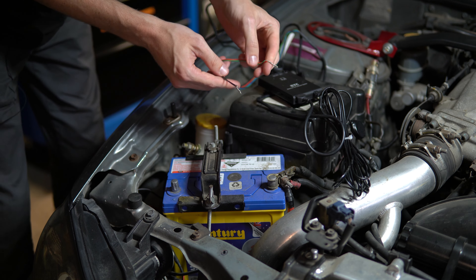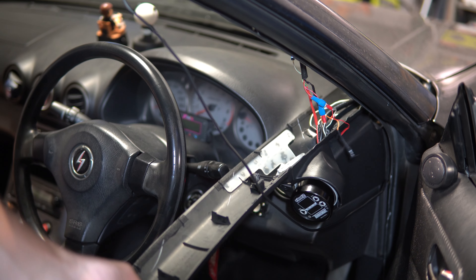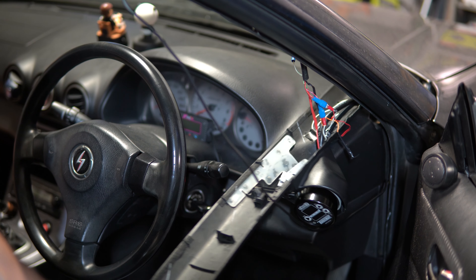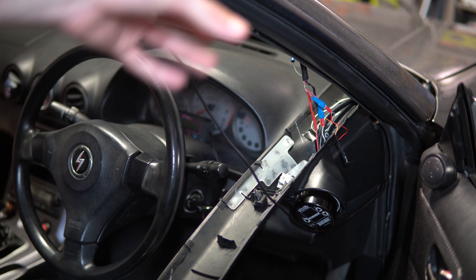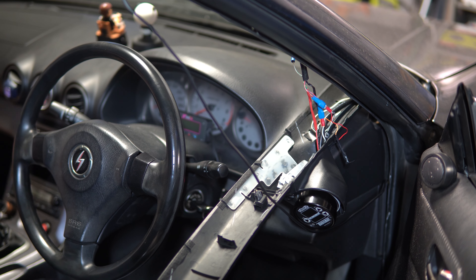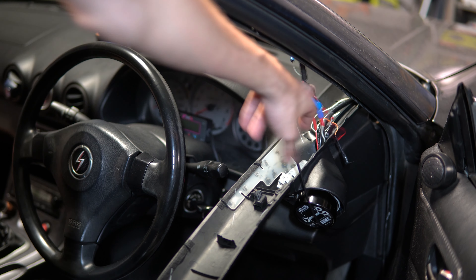That's all ready to go into the car and wire up. You can see I've torn down the pillar gauge just to get to the wiring, because in my instance the easiest way to wire the ETC card reader is just piggybacking off these. I've already done the work so we know it's easy enough. You can go to really anything as long as it's an ignition source and a ground — the center console is usually where most people do it, but currently mine doesn't have any power.